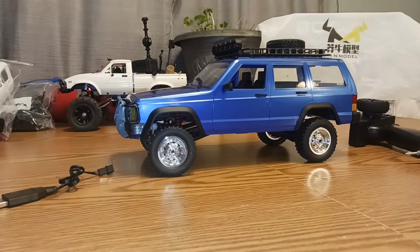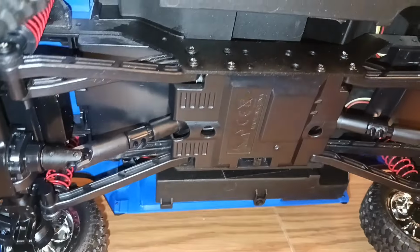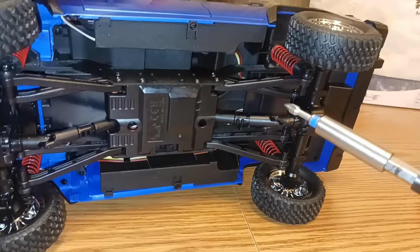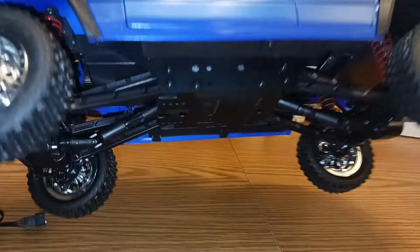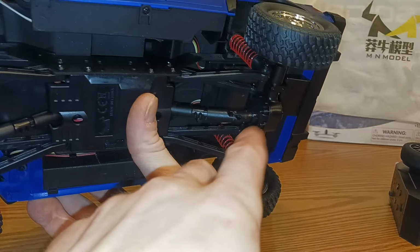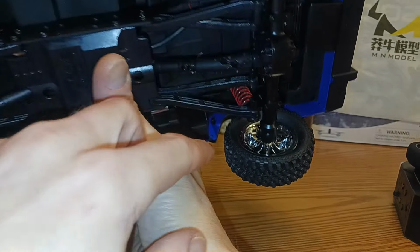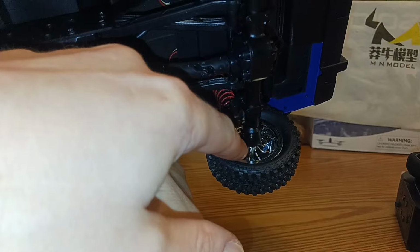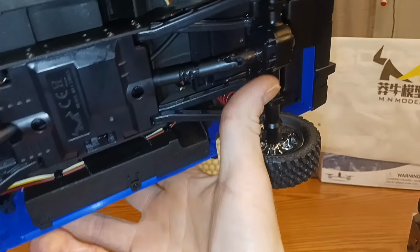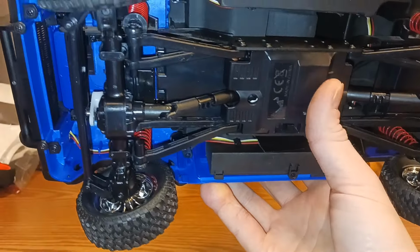That's awesome. This bad boy comes with a 260 brush motor. I think we can get to it with four screws pretty easy. We got plastic drive shafts we're gonna leave on till they break. If this is just like the Dev Wheels but bigger, and it has the same kind of weak spots, it would be the little plastic hexes that go onto the steel axles, I'm guessing, can slip. And then possibly the hex can slip inside of the wheel because they're such a small 5mm hex. The drive shafts can break and slip. The little drive pinion yokes can break off.